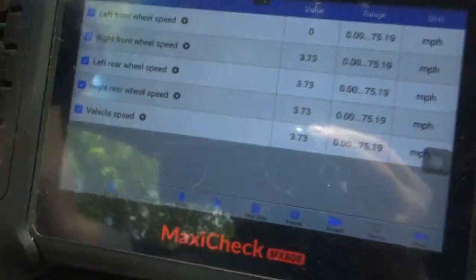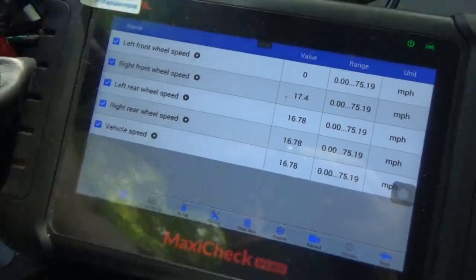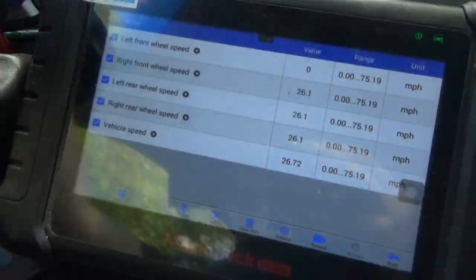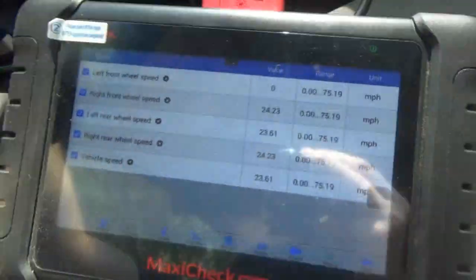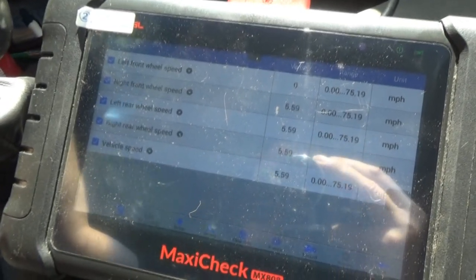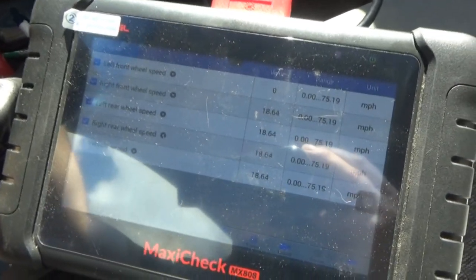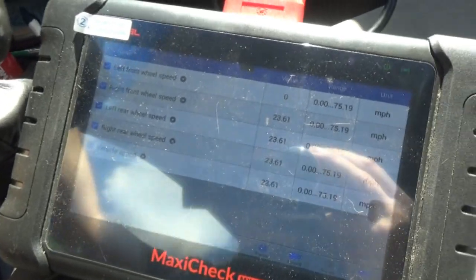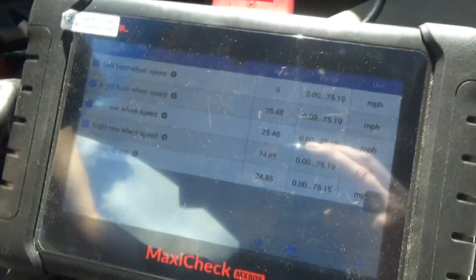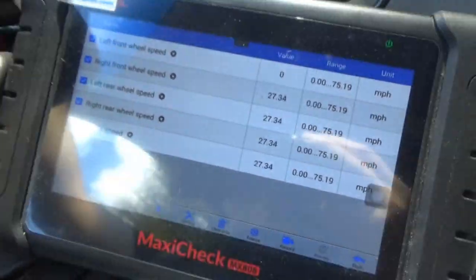So when we get home, after I eat and such, we're going to use our meter to see if we have any continuity in some of the wires and the pins through the actual wheel hub also. The last time I tried to look at this, I really didn't look. I just tried to take a look without putting the car up on the jack or taking the wheel off, but I thought maybe a wire may have gotten ripped out of the connector, because it looked like it's not sitting right. This hub may have been replaced before, but I could be wrong. Like I said, I didn't really get that good of a look.